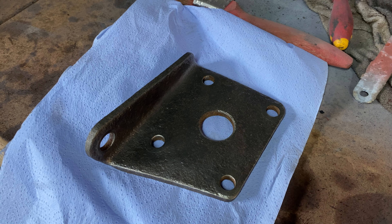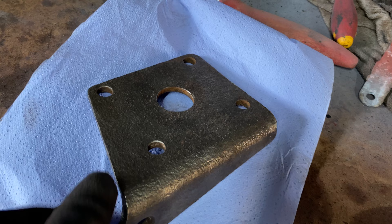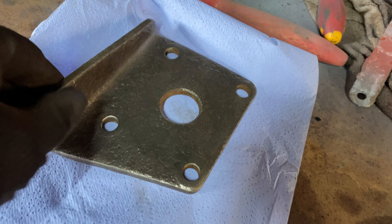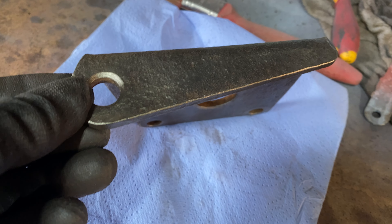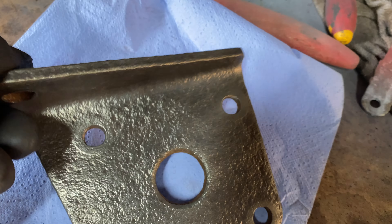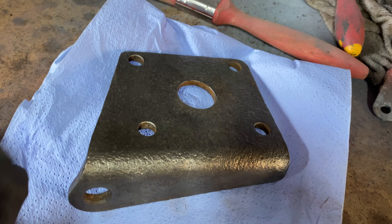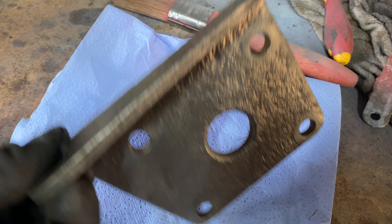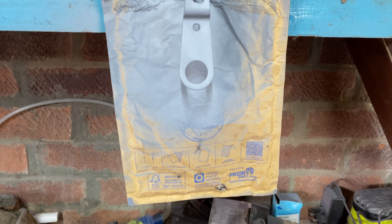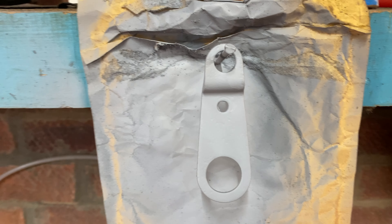That's stage one — that's with the wire brush on the grinder, and as you can see it's got the majority of the rust off. Cleaning parts up like this — it's in primer because it's a bare metal surface. It's cleaned up well. It'd be silly to buy a new one; I think they're about 25 pounds each from what I've seen on forums and websites.